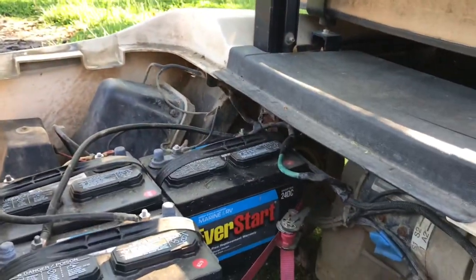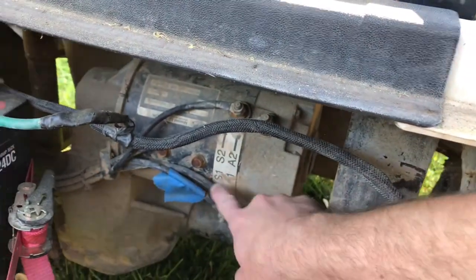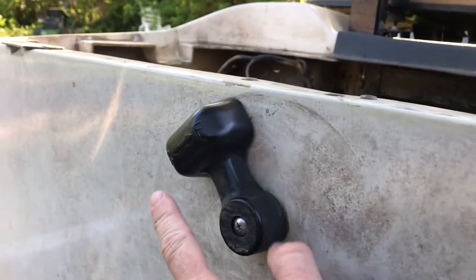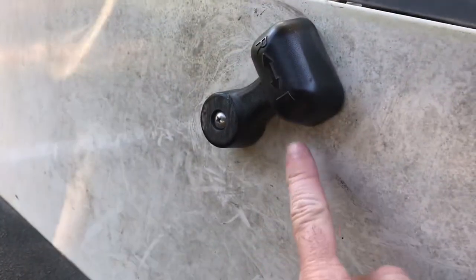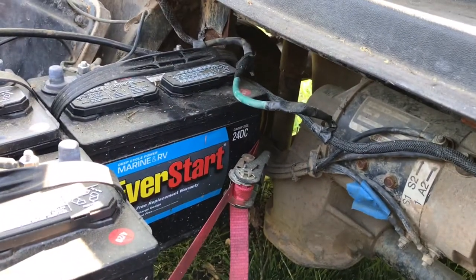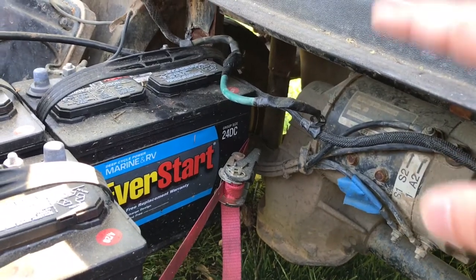Since the last video, that's really all I've done. I did an S1, S2 swap when I made the battery swap, and that basically reassigned forward and reverse — it's in forward right now, but if I change it over, that's actually reverse. I had to do that because it just felt like I had no power when I was in drive.